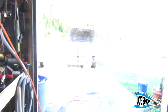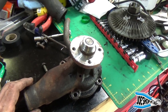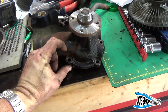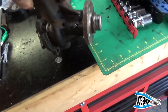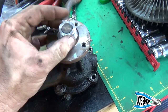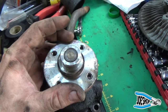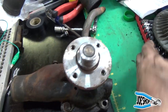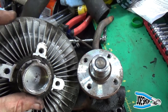I've got the water pump in the Ford. For those who have the old body style Ford with the 4.9 liter — I'm sure this water pump goes to any number of different models — but in the middle of 1992, Ford switched water pump styles. The distinction is the bolt depth: the new one requires a longer bolt. There's also a 30 millimeter pilot on one and a 33 millimeter on the other. I got the new water pump not knowing it was the new style, and quickly recognized it because of the different pilot size — 30 millimeter versus 33 millimeter — meaning my old fan clutch wouldn't work. So I had to buy a new fan clutch.